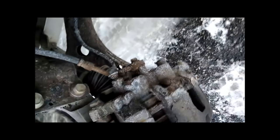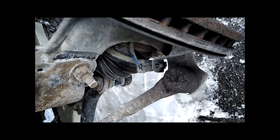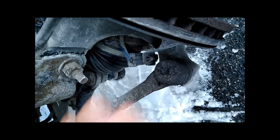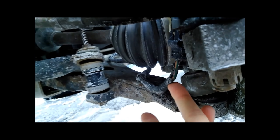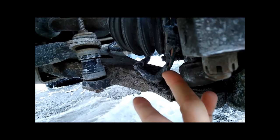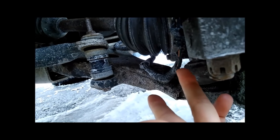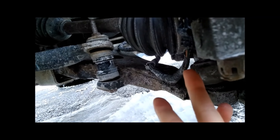Now we're on the right-hand side of the vehicle. You can see the color of the wire is different — that's because the driver's side wheel bearing was recently replaced, so this is the original with the blue wire. Looking underneath, you can see something's clearly been going on here — the cable has been eroded or damaged by something rubbing against it. I suspect this is causing the problem because the system only fails intermittently and only when making left-hand turns.